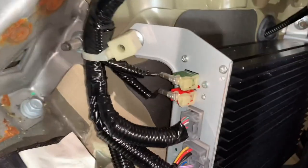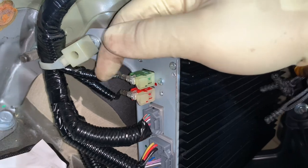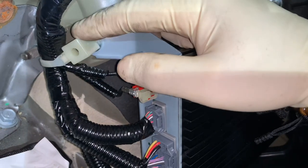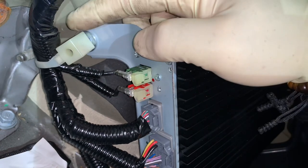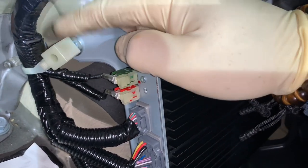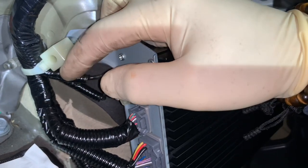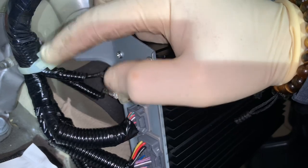What I've found most times is these two wires right here at the stereo amplifier are under a pretty decent amount of tension. I'm going to show you what I do to fix this — I've had great success with this on the Pilot and the Passport. We're going to go ahead and reroute these wires, zip tie it myself, and eliminate this OEM zip tie right over here.